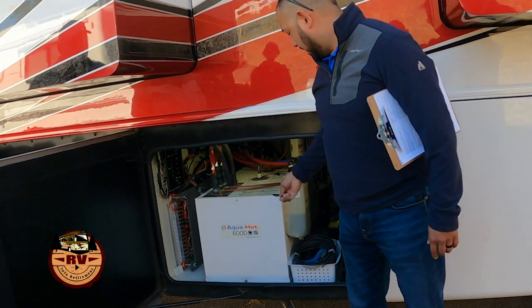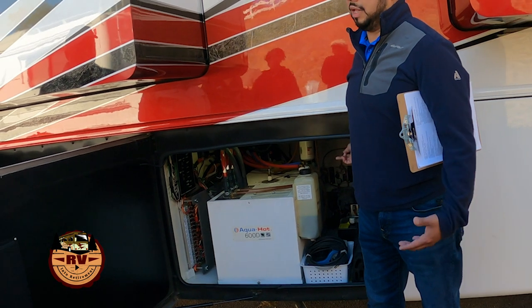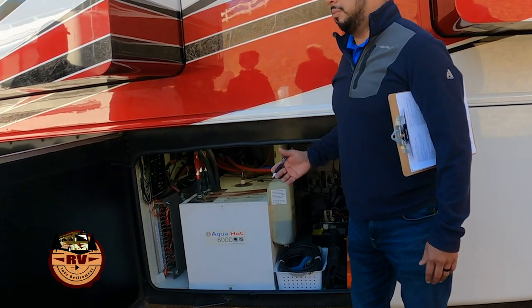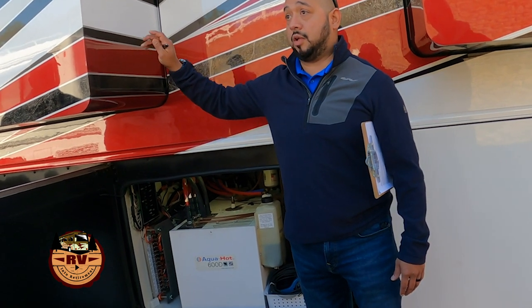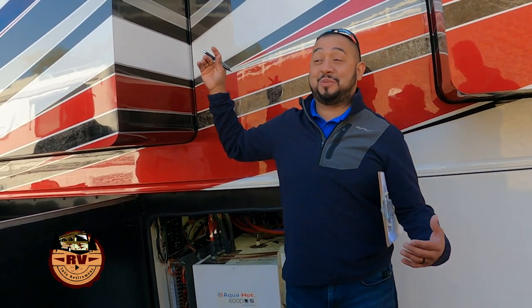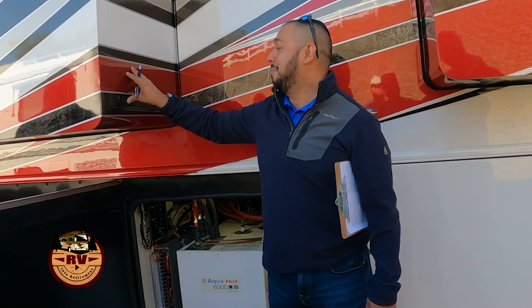Now, if your hydraulics are down and your air is working, then you want to release the pressure on your bladder, and then also release the pressure on that particular solenoid for that room. You might be lucky, and they might be labeled. Rooms, sometimes they wear off over time, or if hydraulic fluid gets on that label, you may not be able to see it, is my point.